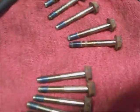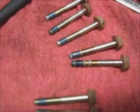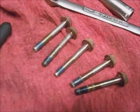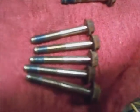These bolts will tighten down to 75 inch-pounds. It's down, but pretty much a little past about hand tight, lightly. All 10 bolts are started and hand tight. Just use a 1/4 inch drive and run all 10 of them down first before tightening any of them, so that they all will be lined up.